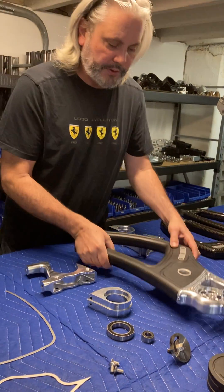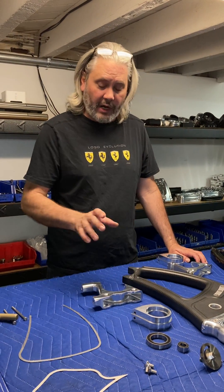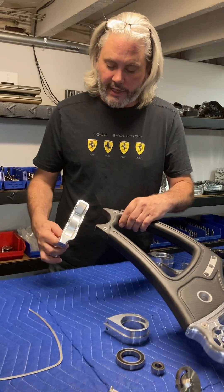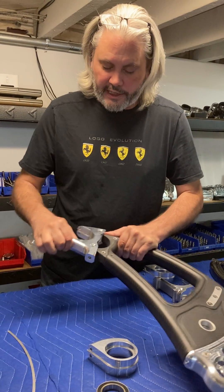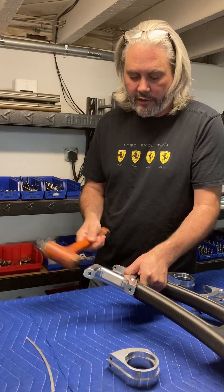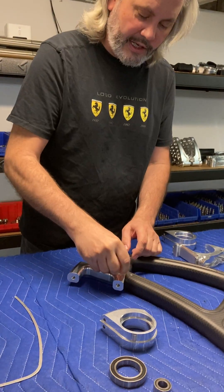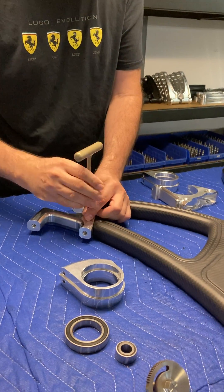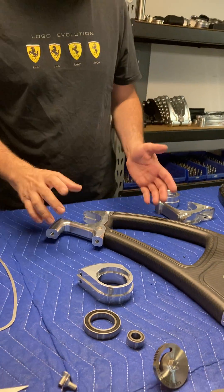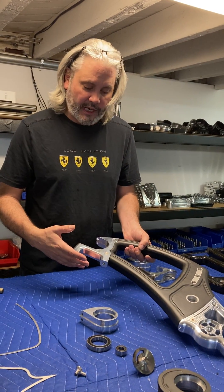So these parts are all universal. Now if we want to take this girder blade and make it a girder blade that bears a brake, I would select this dropout. It's exactly the same system — set up so that it fits inside of here with a bonding agent. We put structural adhesive and then hardware, and now we're set up for a front right-hand side that has the brake caliper.